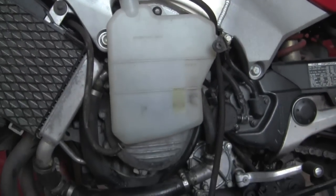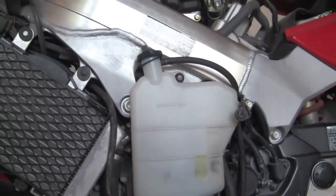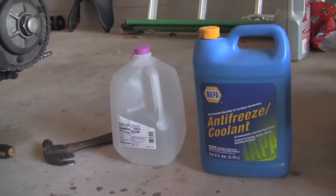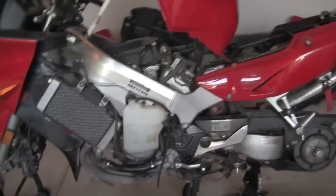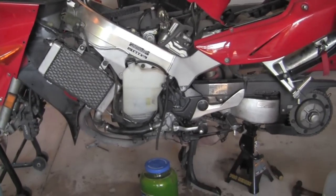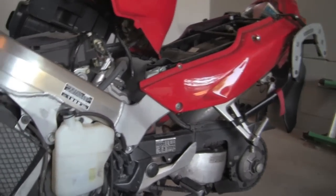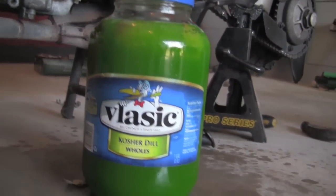Alright guys, we're bolted back up. Everything's been drained — I have no coolant left in the motorcycle. I'm not going to show you how to put coolant in because it's pretty simple. You mix your antifreeze roughly half and half with distilled water during the summertime, then you burp the bike a couple of times to get the air bubbles out, but other than that it's really simple. I thought it would be fun to make this video, and I'm starving to death, so I'm gonna go inside and make some dinner. Until later guys!